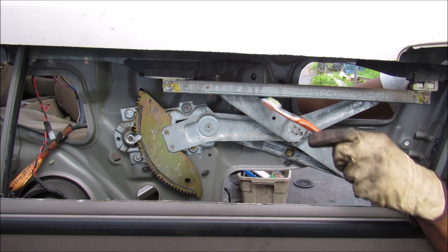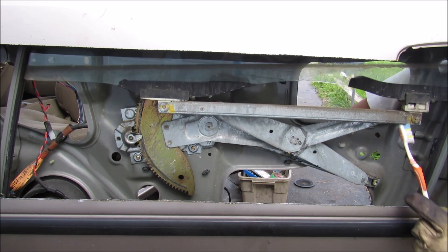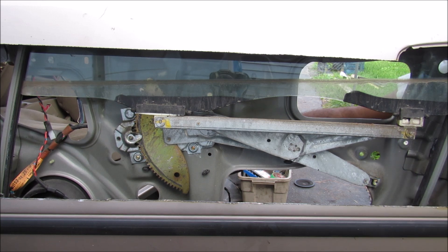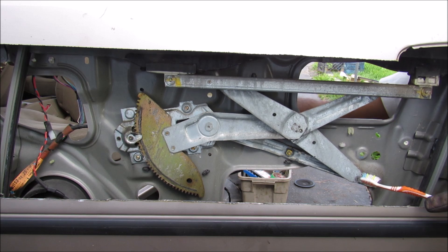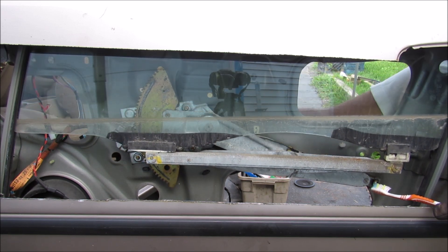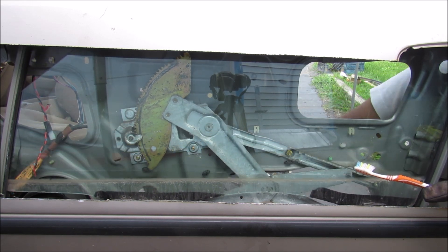However, these two cross pieces on the scissors are actually a separated piece and they pivot in the middle. You can also see we've got a cross beam on the front and back of the window that distributes the load between the two. As I'm winding the window down, it will actually reach its maximum position as the scissor mechanism maxes out, and then when I keep winding it down it will start to retract a bit and go back inward.